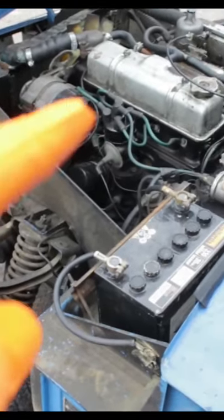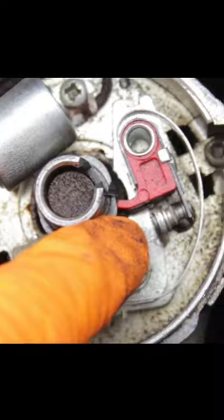The cause of our problem is probably that thing. To remove the clips, there's one here — push downwards and away — and there's one here. Now we can just take the cap off. This red thing needs to line up right at the top of one of these lobes.